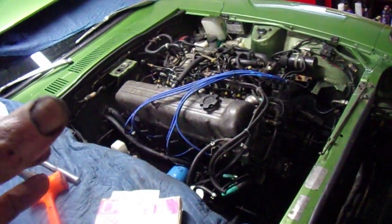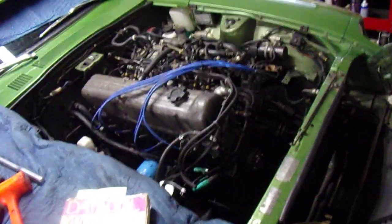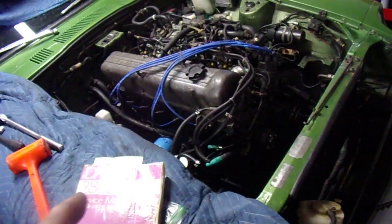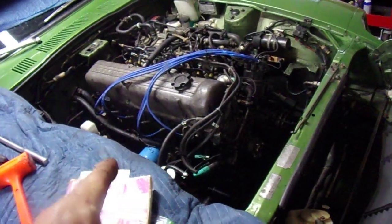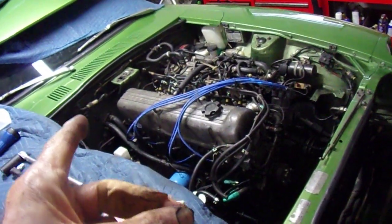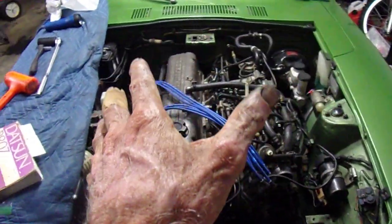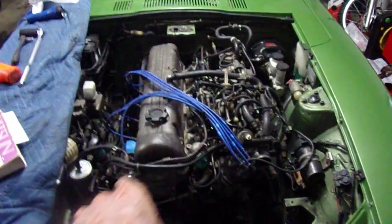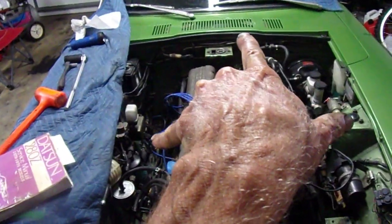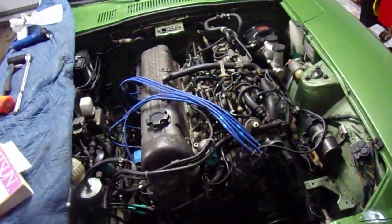Taking the engine out with the transmission in place was no big deal, obviously. Getting it to go back in was a whole another level of effort, a whole quantum leap. We just could not get the angles to line up between the motor mounts, getting around the compressor, and mating it to the transmission with the engine. The engine constantly wants to lean over a little bit. Using the way the mounts are on the engine, it tends to want to sit upright. It just got to be too much. Okay, it just was not happening.